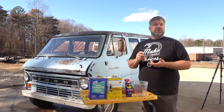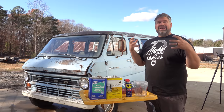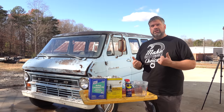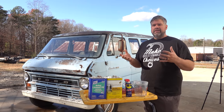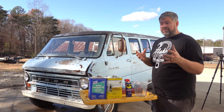There is the option of clear coating it, where you'll fully pull all oils out of the metal and actually spray an automotive clear coat. It kind of seals everything in. Now that generally is very, very glossy, and there are some things you can do to make it a little bit more matte, but it's a lot of effort, and I'm not the biggest fan of that look because it almost pushes it down that look of the faux patina, the fake patina.